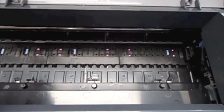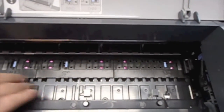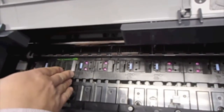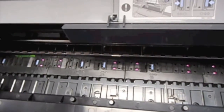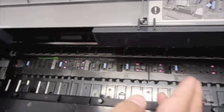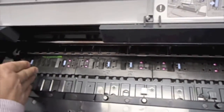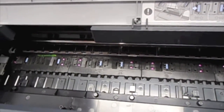And full bleed printing must be a roll-fed function. You cannot full bleed a cut sheet media. It has to be roll-fed media, and it has to be certain preset widths. So let's see, this is a 24-inch printer here, probably 20, probably 17. So as you go through your print driver and select borderless printing or full bleed printing, so there's no white border around your print, just pay attention that it has to be roll-fed media and certain preset media widths. It cannot be any arbitrary width size for full bleed printing.